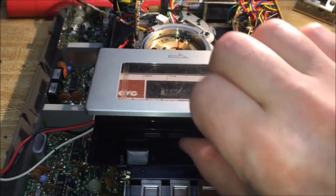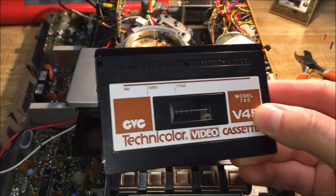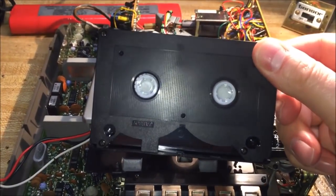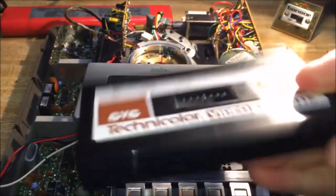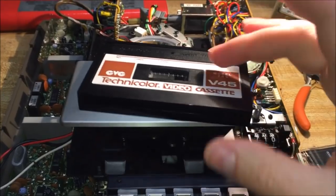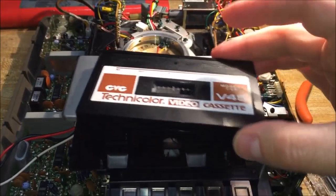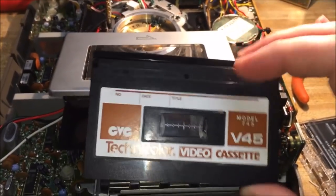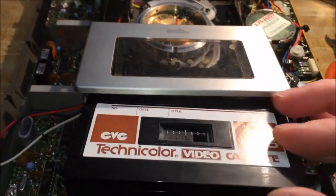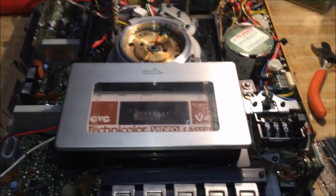Let's eject the tape and I'll show you what the tape looks like. At first I thought the reason this thing won't rewind or fast forward is because the tape is old and jammed up. I even took one of these tapes apart, and on the inside, just like a cassette tape, it has those slider-type sheaths — it's like a sheet, actually, and there's two of them sandwiched on top and bottom of the tape. I tried to replace them with ones from a cassette and that also didn't fix it.